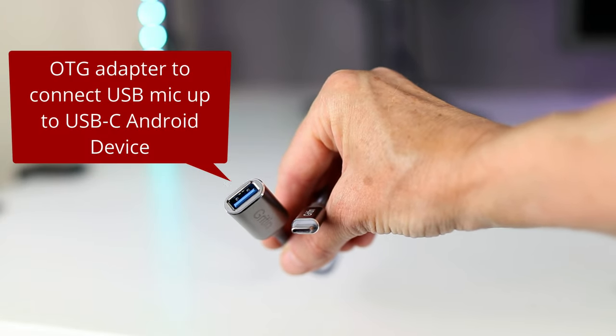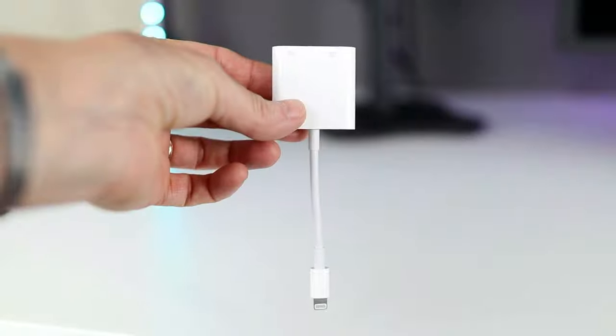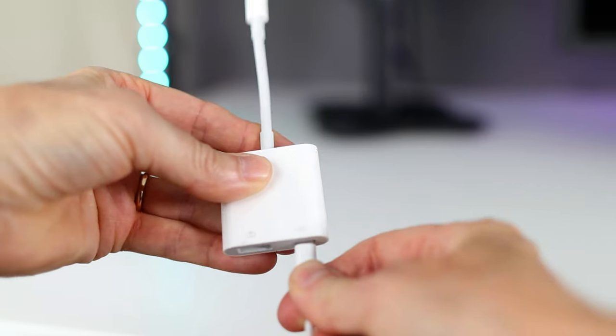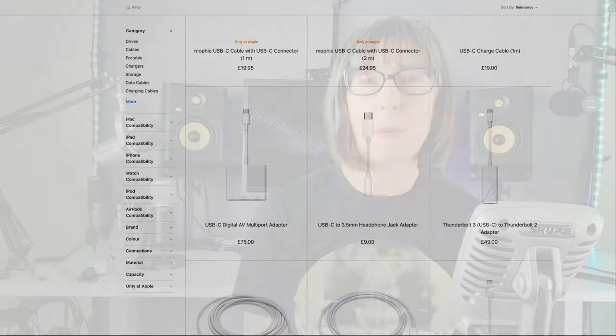This adapter is obviously for USB-C, but in the past I also used a micro USB OTG adapter with an older Android phone and it worked just as well. For a Lightning iOS device, my trusted friend is the Lightning to USB 3 camera adapter, and it's very important you buy the one that also has a Lightning port to power it while you're using it — otherwise your Lightning iPad or iPhone may not supply enough power to the microphone. With newer USB-C iOS devices, various adapters are available from the Apple store; just double-check the power situation before you buy.